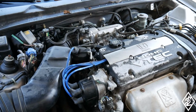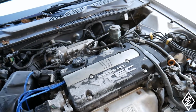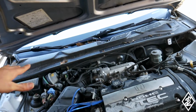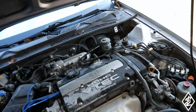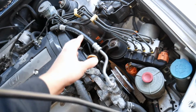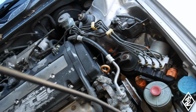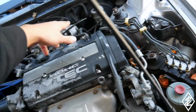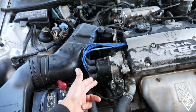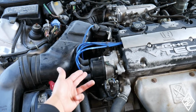And the other thing that I will need is a harness, because the reason why it's misfiring is because now it's using an OBD1 ECU, and those do not have a crank sensor located over there. If you guys have seen the oil pump, there is a crank sensor that just goes on the crank itself. So you're moving that sensor onto the distributor. On OBD1 ECUs, it tells TDC through the distributor itself.